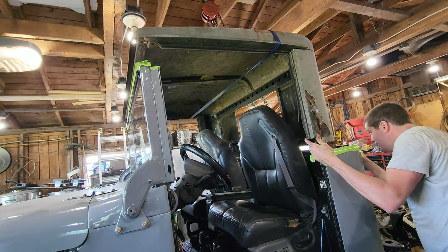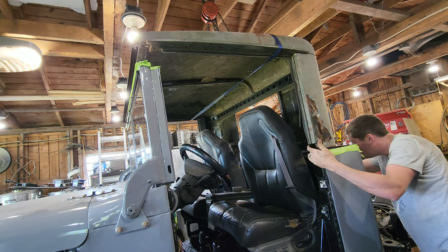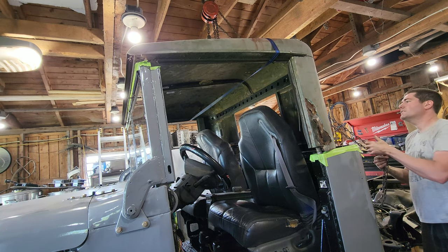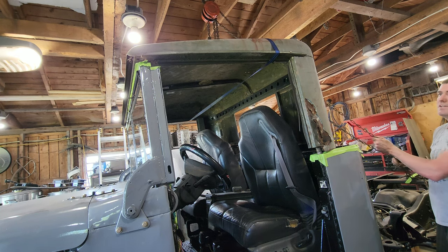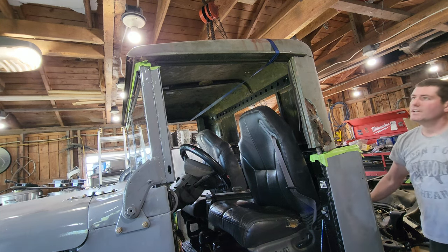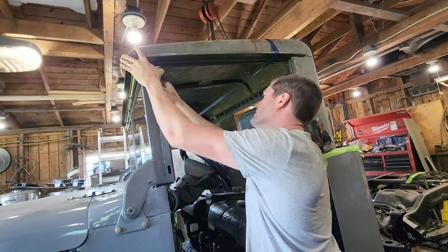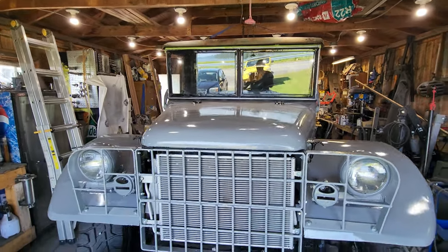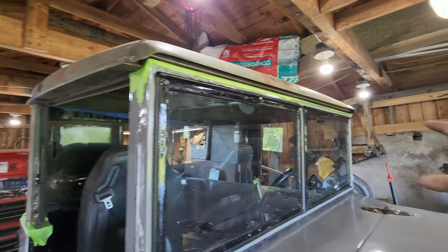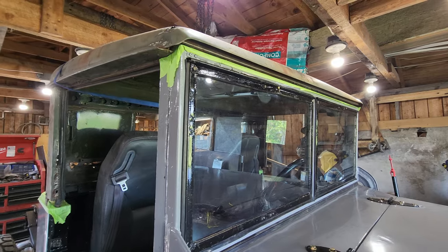I guess I know what we're fixing when we get to that, let me get it off. Both B pillars are touched down. And the load's off of it. Alright. Well, most of it is, anyhow. So I pulled the windshield forward just a little bit. I unhooked it just to see if she fits square and all that. And it looks like it does in this corner. On that corner over there, it's a little high, but nothing you can't just screw it down and lock it in.